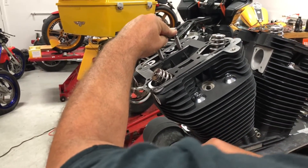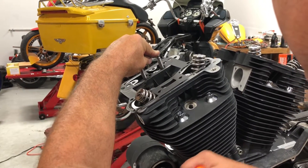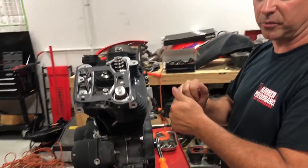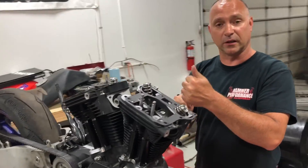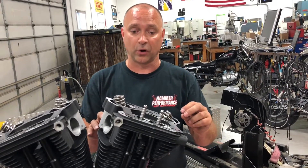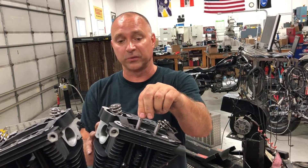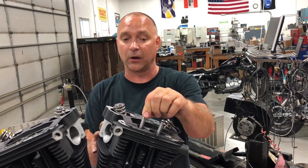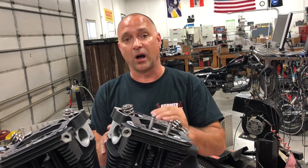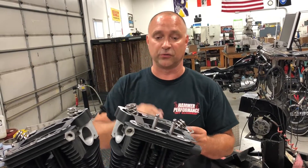What we want to see is the intake push rod go up and then go down. What's happened is our lifter and cam has pushed the push rod up and opened the intake valve, then closed the intake valve. Top dead center on the compression stroke is the piston all the way to the top after our intake valve opens and closes — after the intake push rod goes up and goes down.